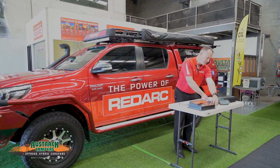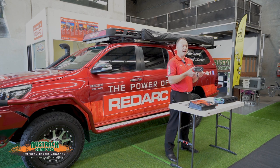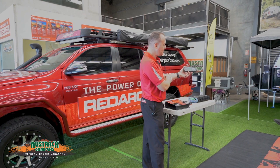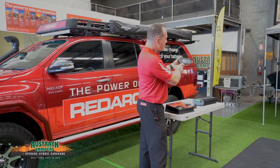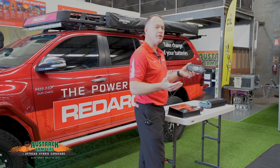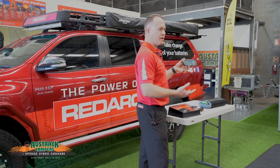The last part of the system is the screen — this is the interface you'll have with the units, and probably the main area where you'll see what's happening with the system at any time. On our home screen, we have the ability to see how much power we've got as a percentage. Rather than looking at a one-volt window, we now look at our state of charge as a percentage, giving us a hundred increments to see how much power we've got left. We can also see how long we've got till full or flat based on what loads are on the system.